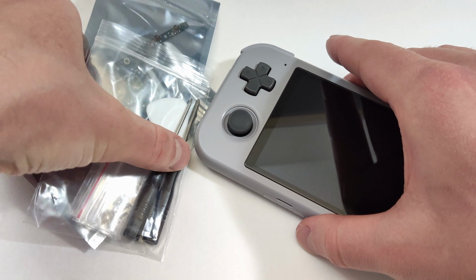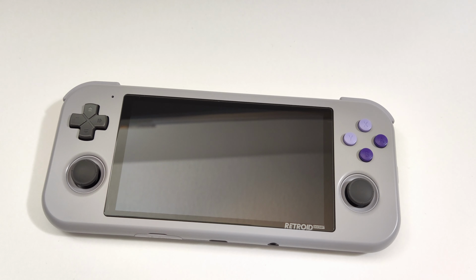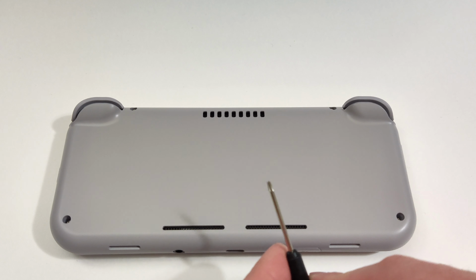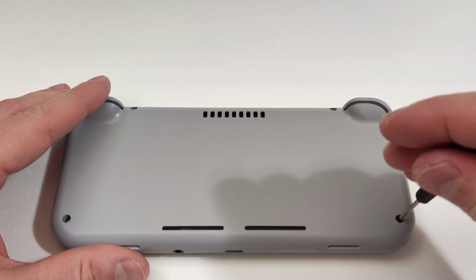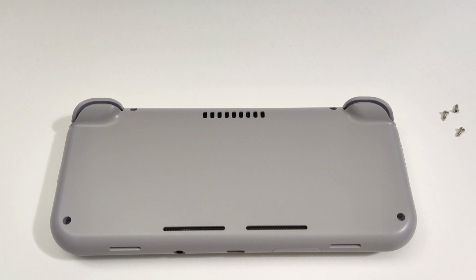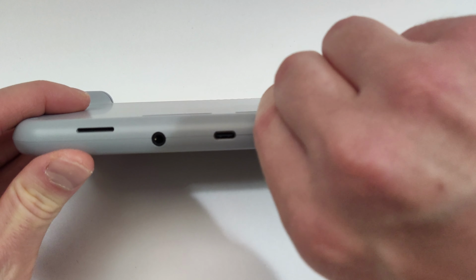Kinda hoping this isn't too difficult, so I can easily recommend doing this as a worthwhile upgrade. I'm going to use the included screwdrivers as they intended people to use them to see how they work with the upgrade kit. We need to take off the backplate first, so let's take out the 4 screws holding it in place. With the 4 screws out, make sure to remove your microSD card from inside the unit.